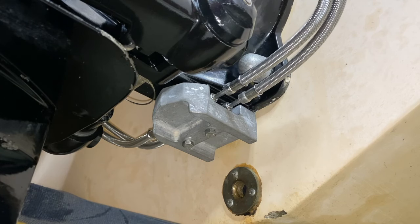Now to a close-up view of the larger anode located at the very bottom portion of your transom. As you can see, there are two bolts — in our case those are 7/16ths in size — and it is very easy to remove. Just grab your ratchet and a 7/16ths socket and turn those bolts counterclockwise to remove your old anode. In addition, in between the anode and the hard-mounted fitting that the hydraulic hoses feed into is a gasket. It is important to remove 100% of that gasket — carefully peel it off. Your new kit will come with a brand-new gasket. Compared to the one we showed you at the workbench, what a significant difference. The torch has been passed, and the new anodes are ready to carry it from there.